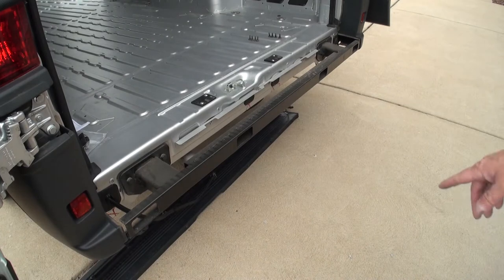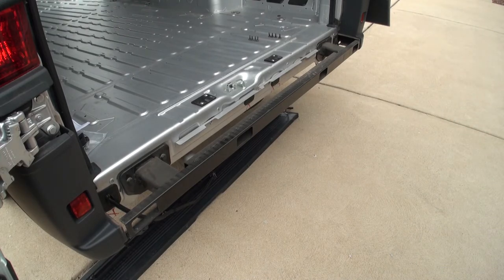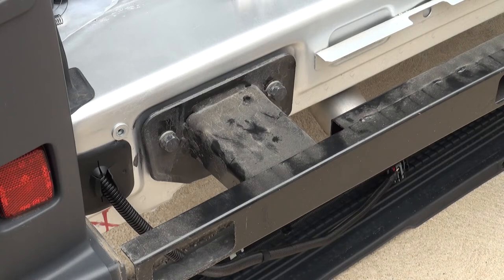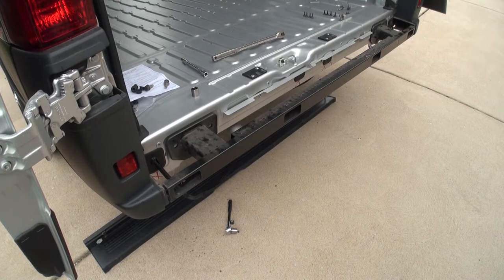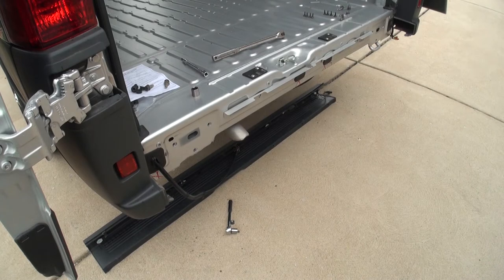And there's my seven pin. Next we'll take out the four bolts that hold on the main factory bumper — I think it weighs 18 pounds. The Mopar OEM replacement tow package we're putting on today weighs like 65 pounds, so it's pretty beefy. To remove the rear bumper assembly, you'll have two bolts on each corner on the top outside, and then one underneath. The instructions call for a 16mm on the outside and 15mm underneath. At first I thought it needed a 17, but there's some corrosion prevention on the heads of the bolts — once I got the socket on it, it was truly a 16mm. I've removed all six bolts and removed the bumper cover. Now that I've removed the back bumper, I'll do a little cleanup and make sure there's no grit and grime between the mounting surfaces.